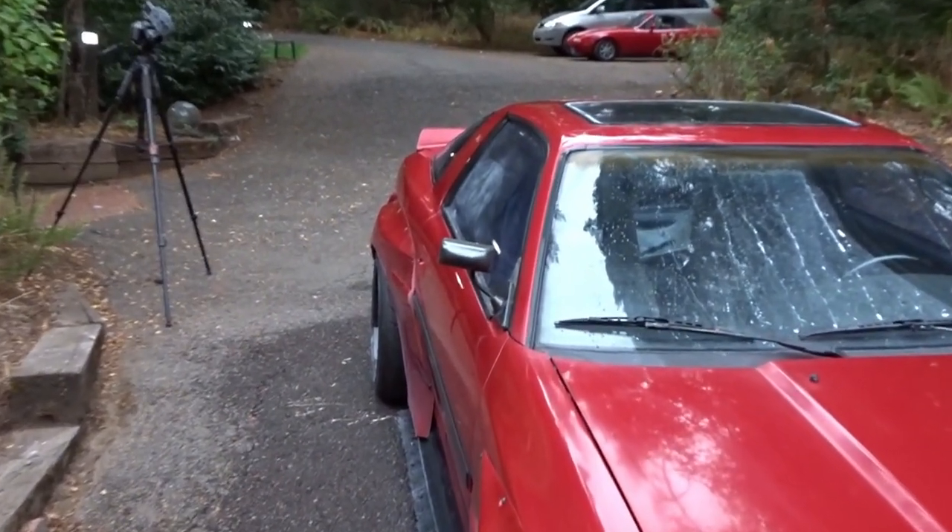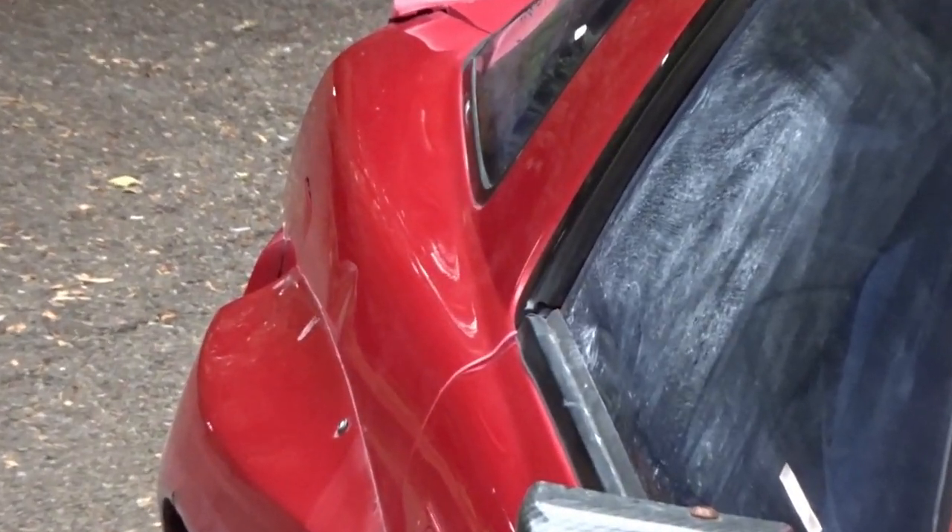The final step is to get that last smooth cut off and then clean the entire car again to make sure it's fully protected. Microfiber pad with polish — let's knock out another layer. It's very much a grind episode but totally worth it. It's nice to have that point where you come out of the paint booth and everything looked rough and you're like 'I really like the color but the paint job looked kind of trash,' and then to be able to say hey, we're salvaging this. The reflection just looks so much smoother — you're not getting those waves from the orange peel anymore.